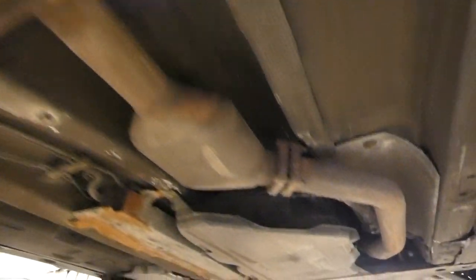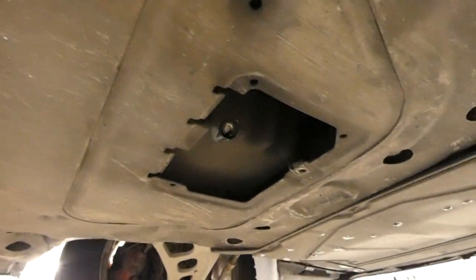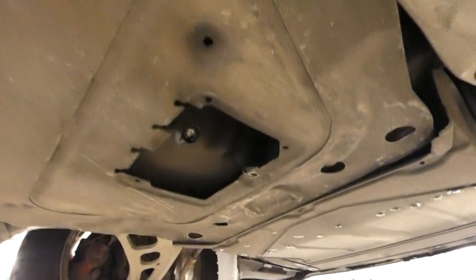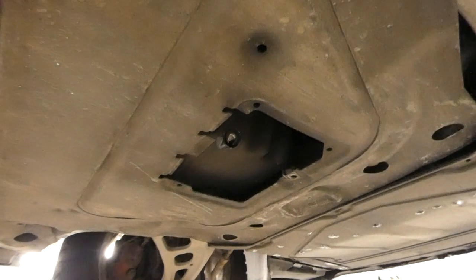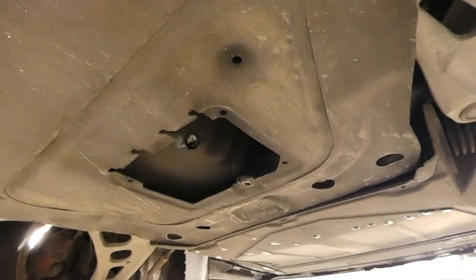And the great heat shield here. I might try to fasten it a better. Or just let it be. So the oil has been draining while I was doing the drive shaft, so now I'm gonna put the plug with a new gasket back in, then I'm gonna go to the upper side, take the oil filter out, change the oil filter and the o-ring on the oil filter housing, and then put some new oil in.